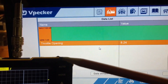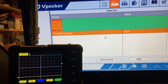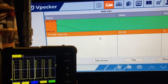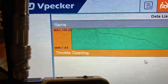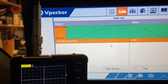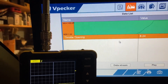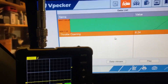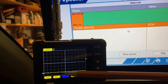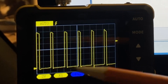Inside the vehicle now — I've got the VPecker in the background just so you can see the relative position of the throttle. I'm going to slowly step on the pedal; you'll see on the VPecker the throttle position actually climb. It won't go to a true 100% open physically — it's limited to about 86%, which is the throttle plate fared completely with the airstream. The VPecker is in the background just to correlate what you're seeing on the scope.